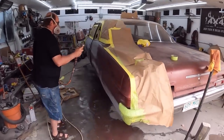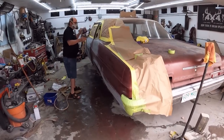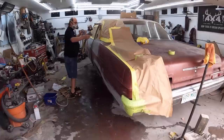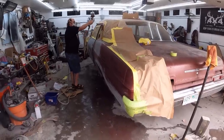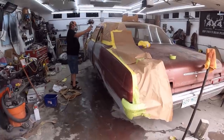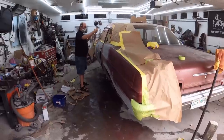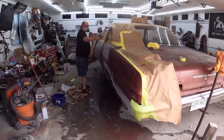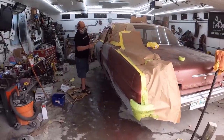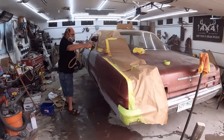So now he's going to lay the paint on. Now, the same as we do on the other side, it's kind of a lot of light, easy coats. If you put the paint on too thick, it'll run. So typically, paint every solid color I've done, you want to kind of put it on there and get good coverage. These, it almost goes on blotchy, which is hard on the mind when you're putting it all together. He's doing a little bit of blend job there with my wicked masking.